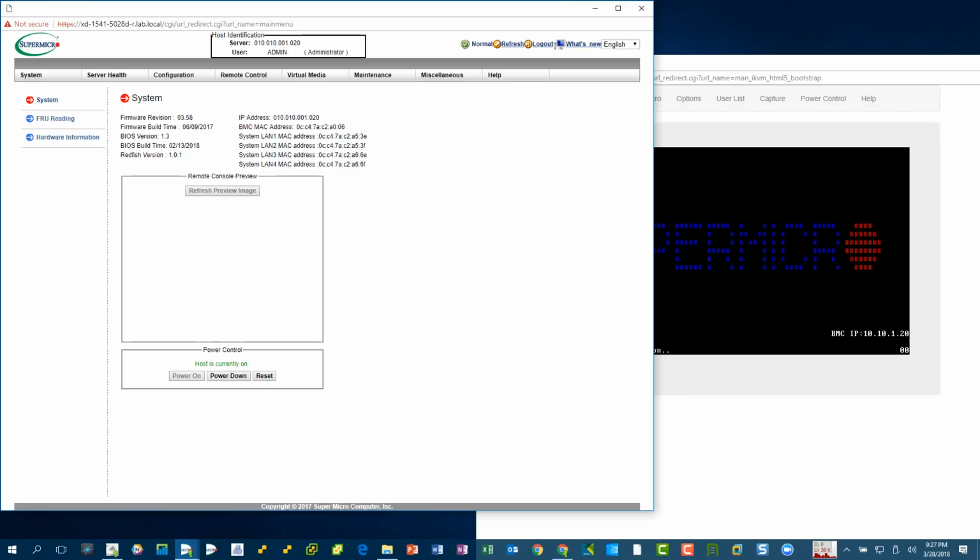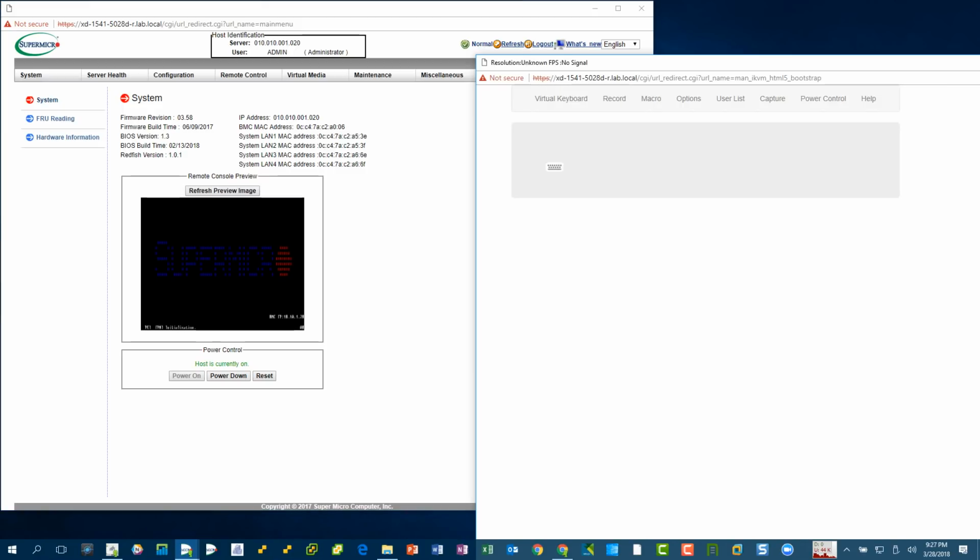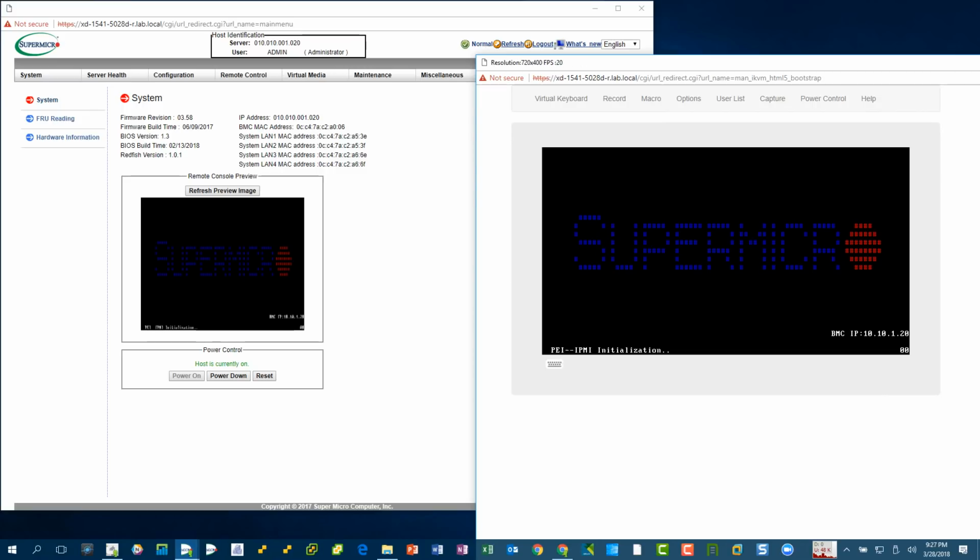It just did what I expected, and that is a double reboot. All right, so that's a good thing. That's what it's supposed to be doing. So now in the second boot, I'm confident that everything's normal. In all my experience, having done many of these and worked with over a dozen Xeon D systems, this is how they act. The second boot, you're good to go, especially since IPMI confirms over on the left we're at BIOS 1.3, and we're going to see that in the splash screen.